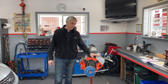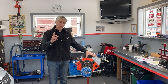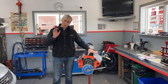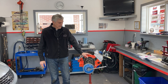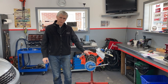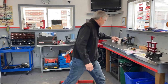About a month ago I made a video about rocker arms, and for that video I took one measurement. I measured the lift at full open at the center line of the camshaft lobe compared to the base circle, and compared that to the lift at the lobe. I published a whole bunch of information — I took probably hundreds of measurements — and I published information on which rocker arms performed best in terms of rocker arm ratio compared to the advertised ratio. I tested about six rocker arms.